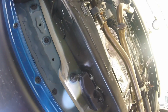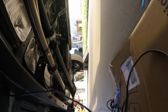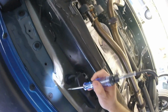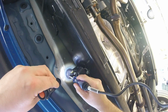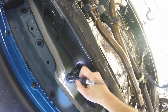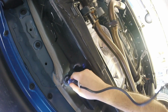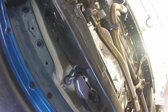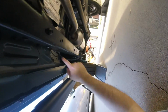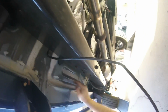So I want this grommet nice and tight. There, I heard it pop. I'm gonna take this circuit tester, it's pretty pointy, and I'm gonna punch a hole right there on the side. There, now, and by the way, here's my harness. It's all the way down the chassis. I put a little bit back in here extra, but it's zip tied all along.